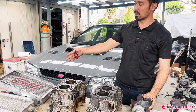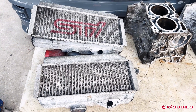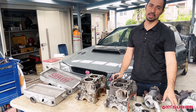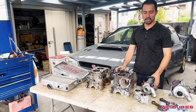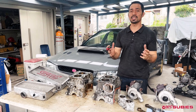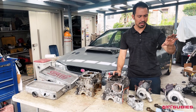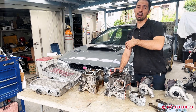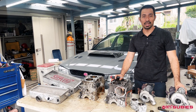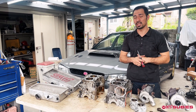Going outside the engine, the intercoolers — the WRX intercooler is smaller than the STI intercooler. To quickly recap: you have semi-closed deck versus open deck, different rods, different turbos, different injector sizes, and better flowing heads. The cool thing about EJ205 to EJ207 is that the casting of the heads in Japan are the same — they both have big ports and both have AVCS. So performance-wise it's actually really nice. We often take the STI injectors and STI turbo, put it on the EJ205, tune it, and they perform really, really well. One of these days we want to try to rev it out to 8,000 RPM to see how long it lasts, because the heads are very, very similar.